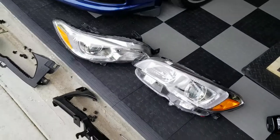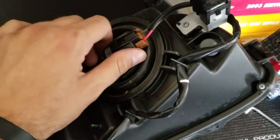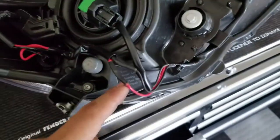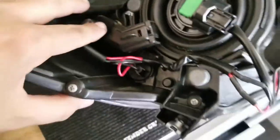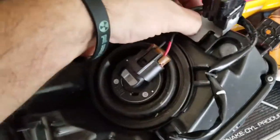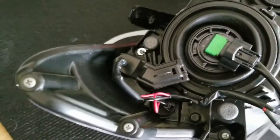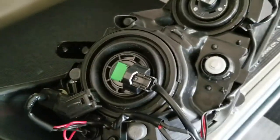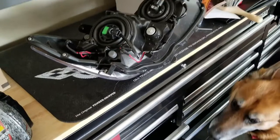Time to start taking apart the headlights. I'm gonna follow the same procedure as everybody else does — I'm gonna bake them. But I'll show you guys the entire process. To remove everything, it looks like we're gonna have to remove this bulb first and the wiring around it. Once we have all of this stuff removed, then we can remove the bulbs. It looks like there's a screw right here to remove this portion. All these little small screws go around there, up there, pretty much everywhere around the bulb. We'll get all that stuff disconnected, and then we'll go ahead and bake them.